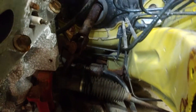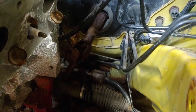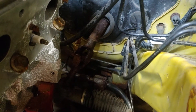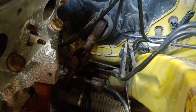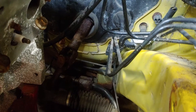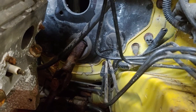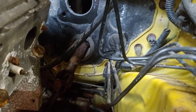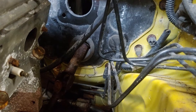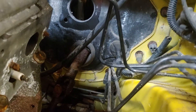Let's look at where the steering is — you see where the intermediate shaft comes out of the firewall. That's kind of cocked inboard and it doesn't have to be. There's a universal joint about six inches upstream on the other side and I can swing that over and bring it out pretty much anywhere. I think by the time I'm done I'm going to wind up just making a whole new firewall from scratch. With everything I've got to do, I don't see a lot of reason to try to save the old one — it's just going to cause more issues than it's going to save any time.